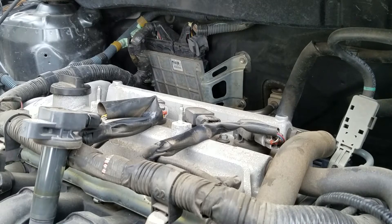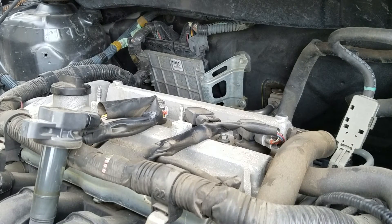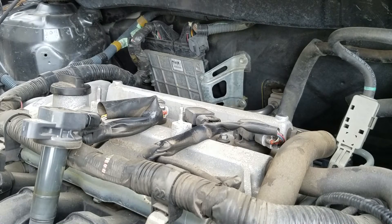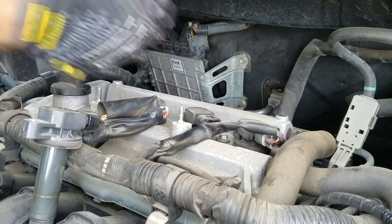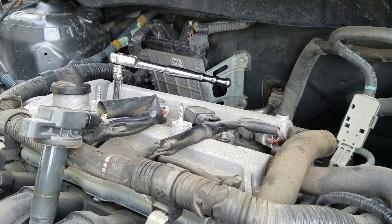The next thing you're going to do is take your spark plugs out of the box. Very important thing — always remember, don't just take your plugs and stick them in and just drop them. You can damage the tip of it, you can close up the gap, so many things can go wrong with that. They recommend you torque the spark plug down to about 15 foot-pounds, so that's what I'm doing right now — I'm getting the torque wrench ready. Also one more thing I forgot to mention: I always recommend that when you put plugs in, go ahead and add anti-seize, because it keeps them from ever being hard to get out.